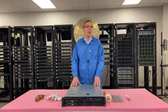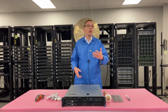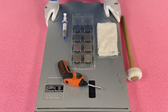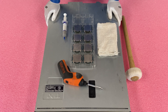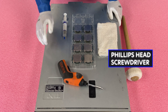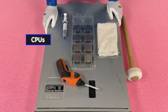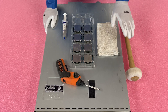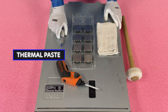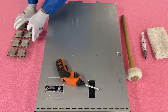Now I want to actually open this up and show you how to remove your old CPU and install the new upgrade. Before we do, I'm going to grab my ESD gloves. I went ahead and put on top of our R530 all the necessary ingredients to do this upgrade. You can use a regular screwdriver if you need — we've got a powered one. Here are the CPUs we're upgrading to — these are E5-2640v4s for this build. We also have a rag to clean the old CPU and thermal grease for the new install.